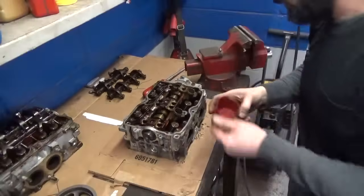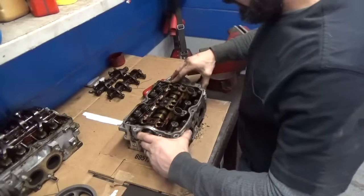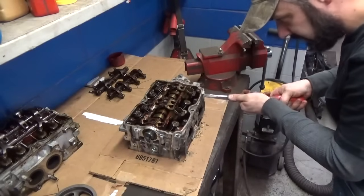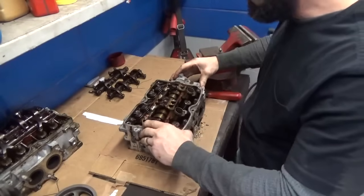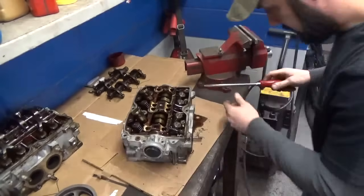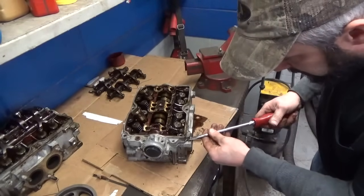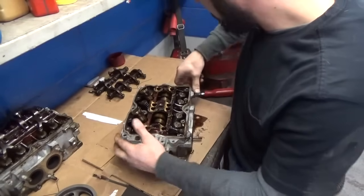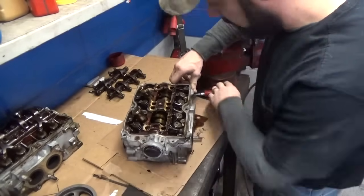Got them all. All right, now we've got to get the upper cam bearing off. These things can usually be stuck on there pretty good, but this one really wasn't that bad. I've had these before; they're stuck, especially on those variable cam ones. Always a little gun shy to take them off. So there should be a dowel pin under here, I assume. Don't get under here with a screwdriver on the bearing surfaces. Don't give it the beans because you can actually mess it up. So go ahead and wiggle it up off here.